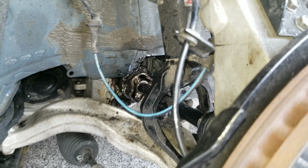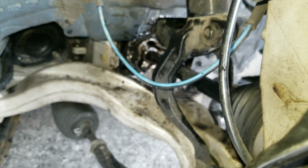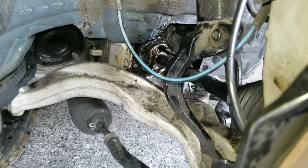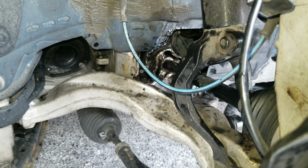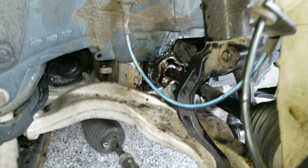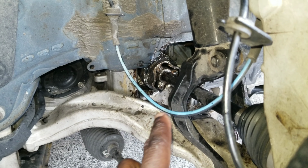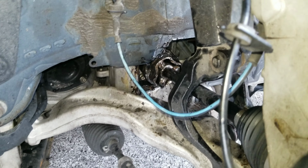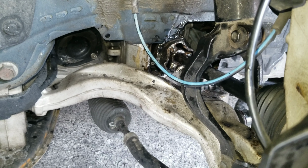Let me see if I could. I can't turn the front wheel. I can't turn the wheel full right. But most likely, when I turn the wheel all the way to the left-hand side, that starts to pull the axle out. Most likely, that axle starts coming this way, and that's probably how I destroyed the casing both times.